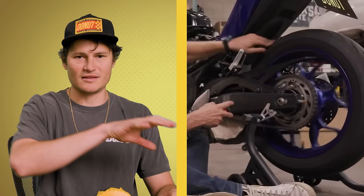You can see the insulator. The spark plug in the head — the porcelain is supposed to be crimped on — has come free and is being pushed up and out by the compression of the engine. The porcelain insulates the electrode that goes down the center of the spark plug; it needs to conduct across the gap for ignition and combustion. This is a $2.79 fix. You take this to a dishonest mechanic and he'll tell you it needs a total engine rebuild. It's pretty harmless, just bizarre.